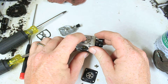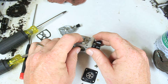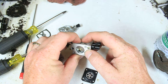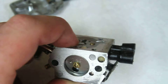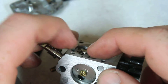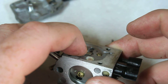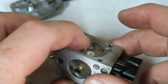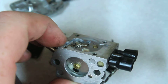The best way to set it — this is how Walbro does it — is that with the chamber surface as reference, the metering lever should be completely level with both sides. With the chamber fully closed, it should just be level like that. That's the closest approximation I can give, since I don't know exactly what carburetor you have.